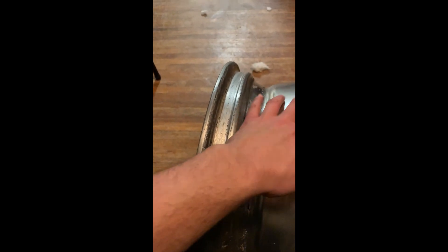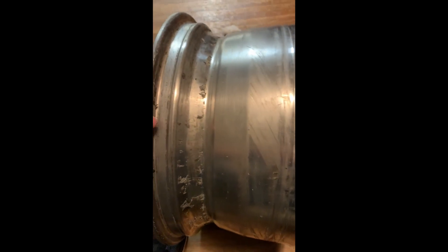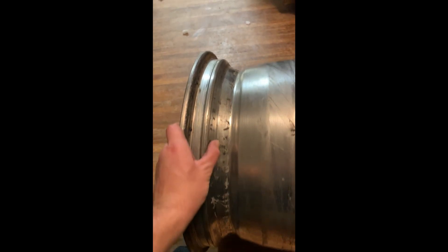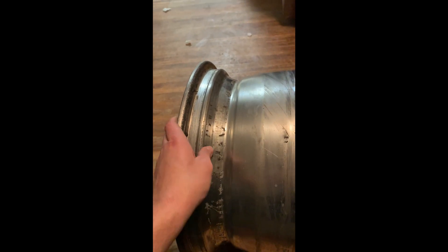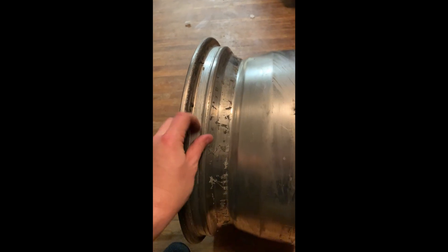When it's doing that, the tire's getting more traction on the snow than the wheel is. So even when the tires are balanced, I go home and it shakes because it just comes unbalanced. I've tried balance beads — more, less — those just didn't work for me. I tried airsoft beads on my old Forerunner. Those were great for the first few weeks and then whatever happened, I don't know, that quit working.